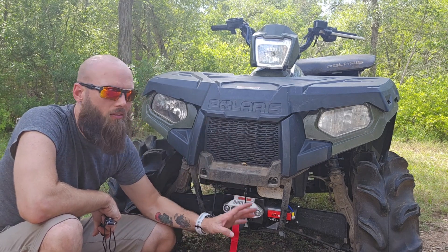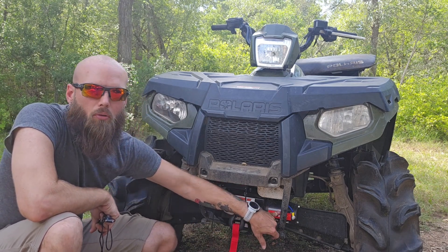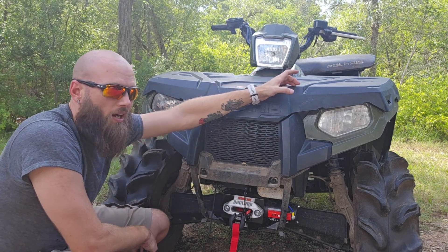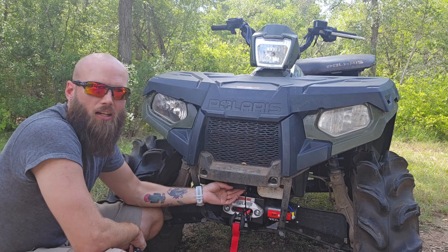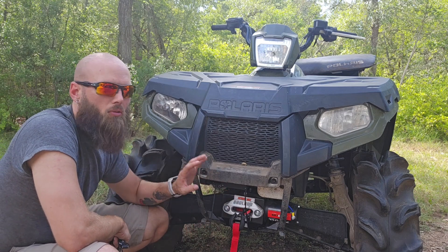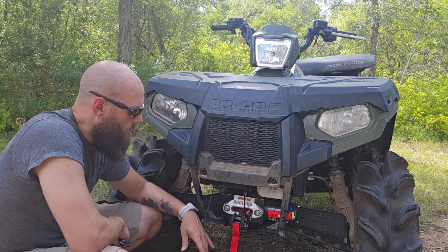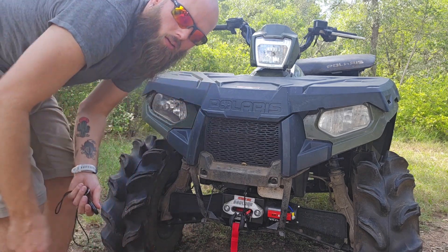What I did — which you can't really see from the angle — is I just zip tied the control module that came with the X-Bull right here onto the frame, and ran my power. Instead of using the Polaris power, because I couldn't figure out where the negative was — I did find a positive wire lead back there labeled for the winch, but I couldn't find the negative and maybe I had it wired correctly, maybe not. Anyway it didn't turn on for me. I just ended up keeping the module up here, ran the yellow and blue that X-Bull shows, and then ran my positive and negative red and black back to the battery.